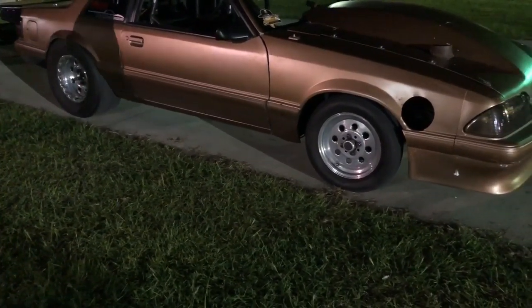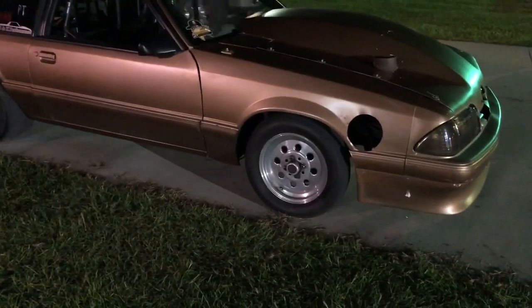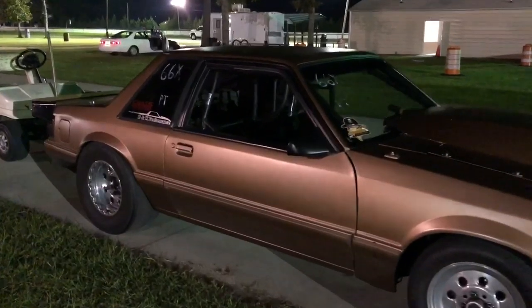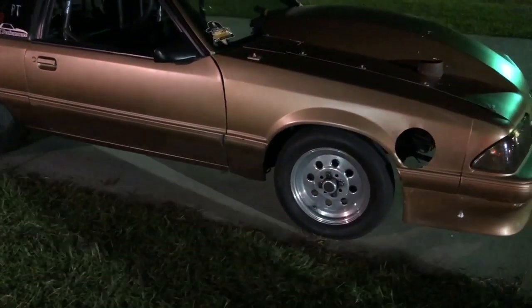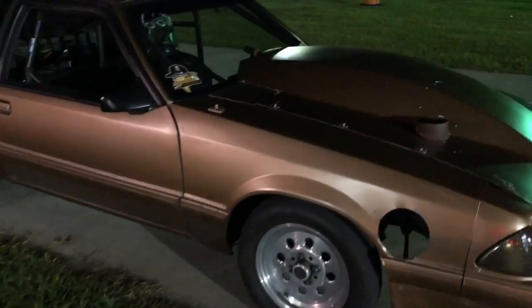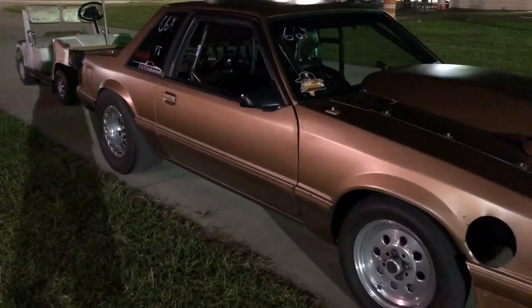I mean, CO2 pressure is pressure, but these things are constantly cycling the solenoid. So it's not like it's there and it holds it because it's not an airtight system. It did rock solid that time. Wastegate feels good now. Hopefully it's fixed. We'll see. We're going to be racing again tomorrow. Hopefully we'll have a good outing tomorrow over at Rico.